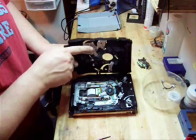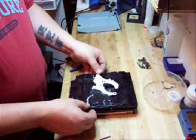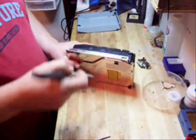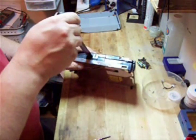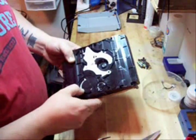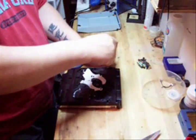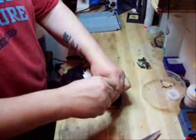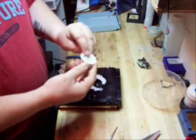This one here actually moves — you can see it wobbles a little bit. So we're going to snap the left side down in place with the clip and leave the right side of the drive open a little bit. Take a little knife, go in back of the clip, see the little tab, push the tab back, and while holding the tab back with the knife, slide it closed like so. Now put the two screws back in, put our magnet back in — make sure there are no screws stuck to the magnet, that'll mess it up.